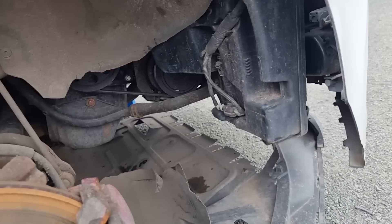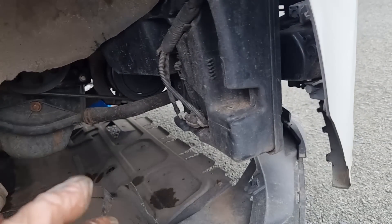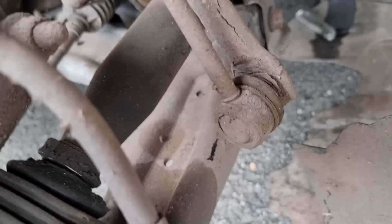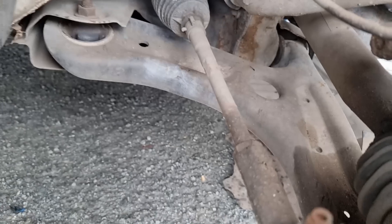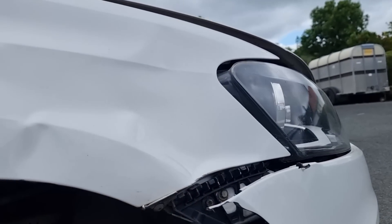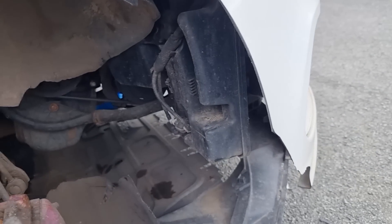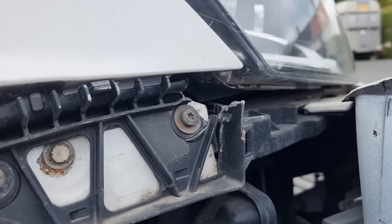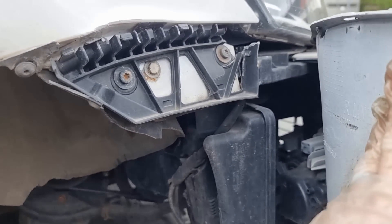As you can see, this side is out of shape as well — it's damaged all the mud guard, it's all split on this side so we know that needs to be replaced. Everything looks reasonably straight down here, no signs of contact, it all looks even. I've got to be honest, I don't think any of this is damaged — I think it's all up on the wing. When the bumper got hit it damaged the mud guard. There's a headlight bracket there that's broken, so we really need to take this bumper off and have a good look underneath.